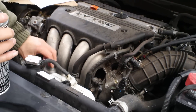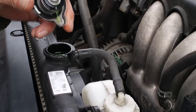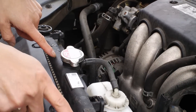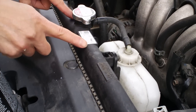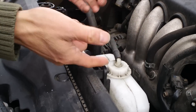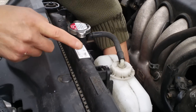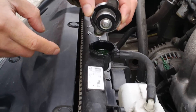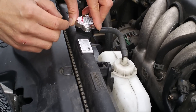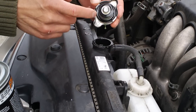That vacuum was caused by the radiator cap — it was dirty. The way the system works is: when the engine is warm, the coolant expands and flows into the overflow container. When the engine cools, it sucks the coolant back into the radiator. Because the cap was bad, the coolant couldn't return to the radiator after cooling. That was the cause of the idle problem — Honda is really sensitive to the cooling system.